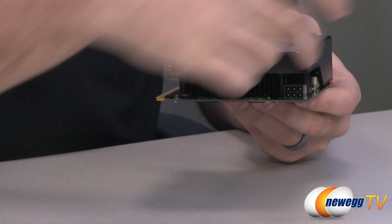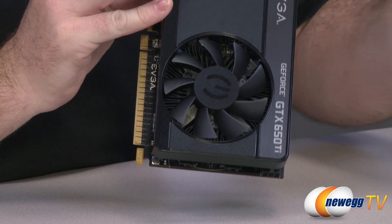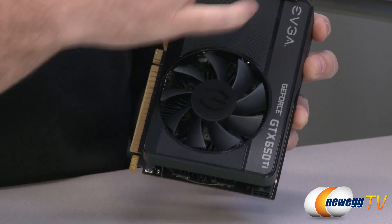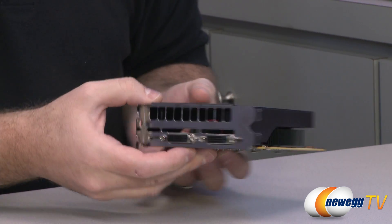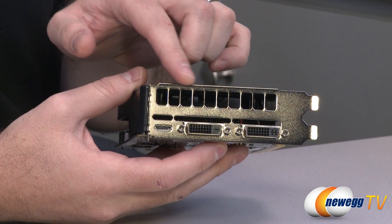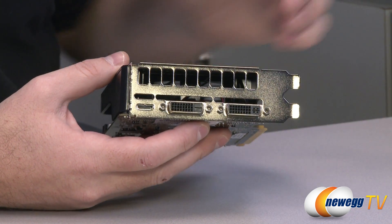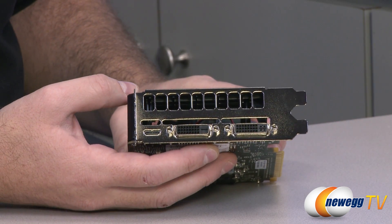You can see the black radial fin array of aluminum fins on the cooler. There's a single fan projecting air down and over those fins to dissipate heat pulled up from the GPU itself, as well as provide airflow over additional components like the power delivery. One of the customizations EVGA makes is wider slots at the back of the video card to help air move more freely out of your case, which helps reduce the internal ambient temperature for the rest of your components.